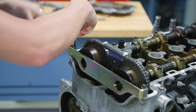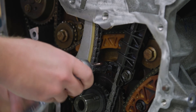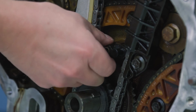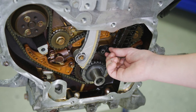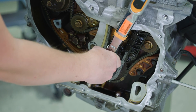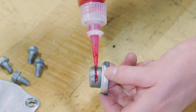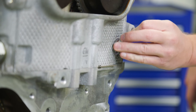Remove the locking tool and old timing chain oiling nozzle. Then install the new nozzle and tighten its bolt to 89 inch-pounds. Apply sealant compound to the thread of the timing chain guide bolt access hole plug, then install it and tighten it to 55 foot-pounds.